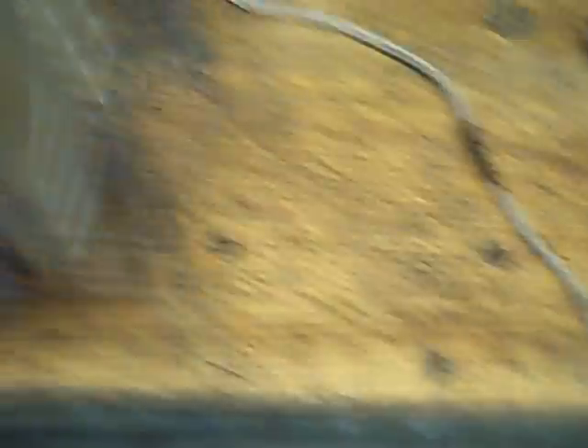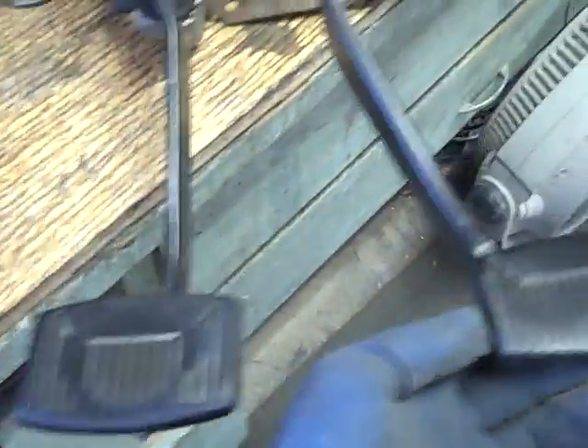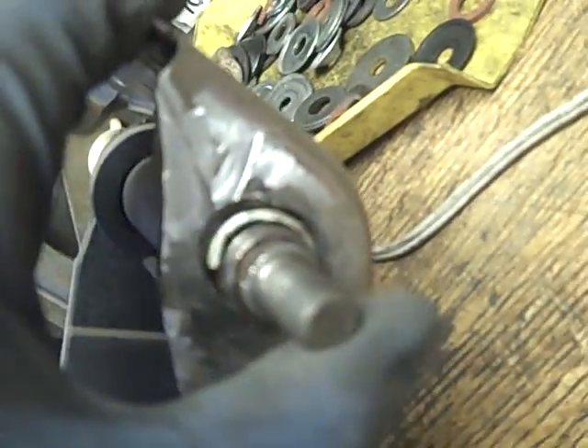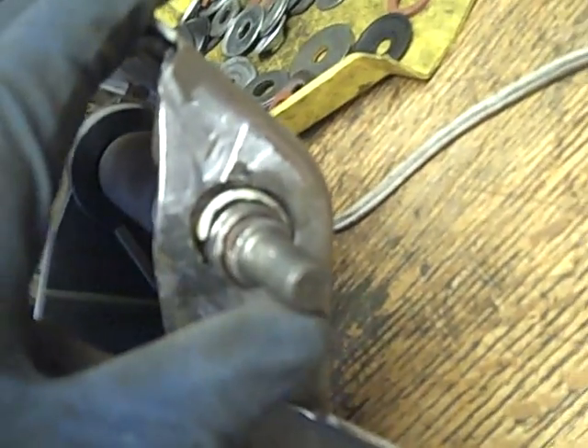As it turns out, this might look familiar. We've got a brake pedal and a clutch pedal. The clutch pedal was losing about — it only moves about an inch and a quarter in order to engage the master cylinder. On this side you can see it's nice and tight like a top. On this side you can see that there's just a bunch of slop. Basically, when they push on the clutch, it only moves about an inch and a quarter.